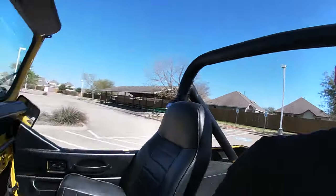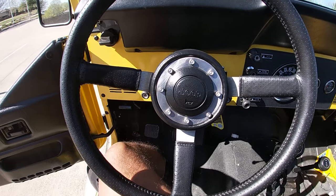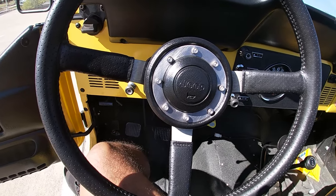But beforehand, I wanna show you guys the steering wheel that I finished up. It's a Laredo steering wheel from like a Wrangler, but it also has the center cap and the rivets. And this wheel was originally a gray color, so I wanted to paint it black to match the interior of the Jeep. And when I was taking it apart, I broke the plastic ring with the fake button head bolts on there. So I ended up fabricating a ring out of steel and adding actual button head screws on there with like Allen key heads. And then just sanding it to give it a brush look and then clear coating it. So I want to show you guys what that looks like. So there it is right there. You can see the brush look that I gave it.